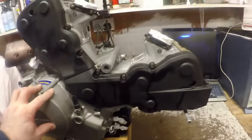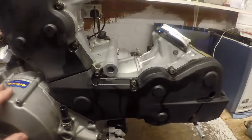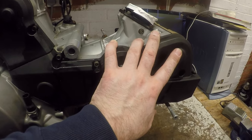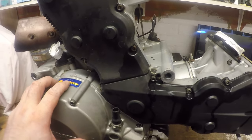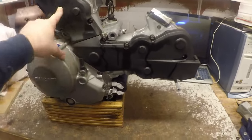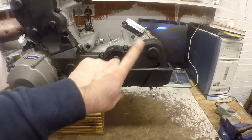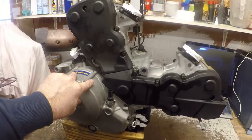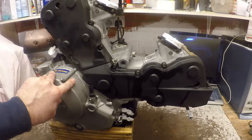So the last task I've got to do to get to the position I needed to get to for this customer is get the heads off and have a look and see what we can find inside. The horizontal apparently has got low compression, so this will be the interesting one and will come off first, and then I'll take off the vertical. First thing I need to do is get the engine into its timed position, i.e. horizontal top dead center. I'll get the covers off and then we will pop the belts off. So we'll release the tension, pop the belts off, then unbolt the horizontal head and we'll have a look at that. I'll then pull the barrel out and have a look at that, and then we'll do the same on the vertical head. So let me just spin this round slightly so I can get the turning tool in and we will get this bike into horizontal top dead center.